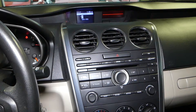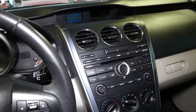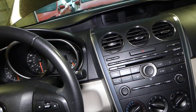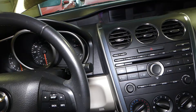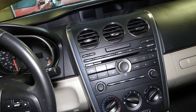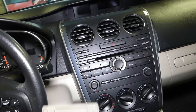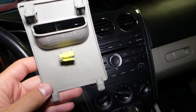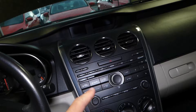Most of the time, the radio on Mazda — especially the newer vehicles — has a fuse that controls it. However, when you check your manual it will not say 'radio.' On many Mazda vehicles it won't say radio; it will say something else. On this Mazda it took us quite a bit to find the radio fuse because it's not listed in the manual, and on the fuse box it's not listed as 'radio' either. Some vehicles have the fuse actually behind the radio, but on this one it's not there. We checked fuse by fuse and found out the fuse that says 'room' — that's for these interior lights as well — is actually the fuse for the radio. They share one. So because of a bad bulb or something like that, your fuse may blow and your radio won't work.